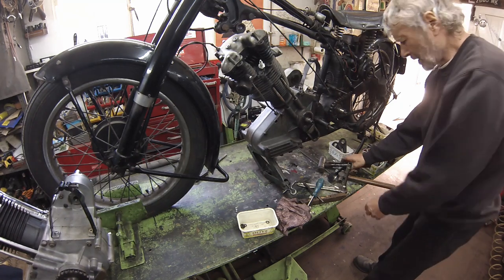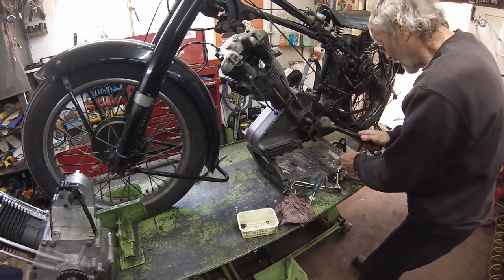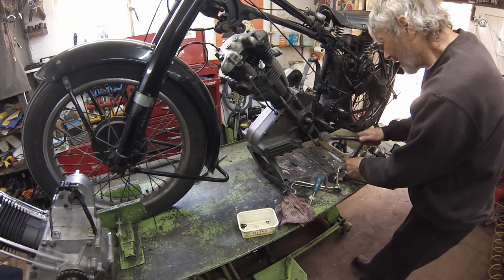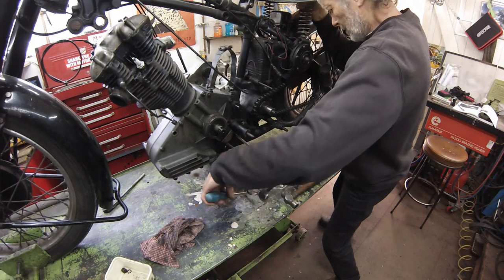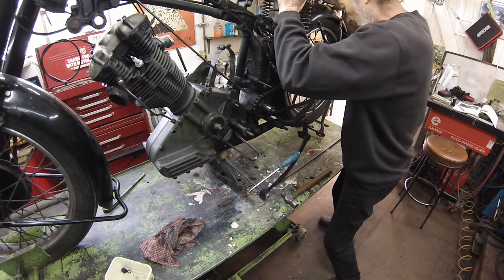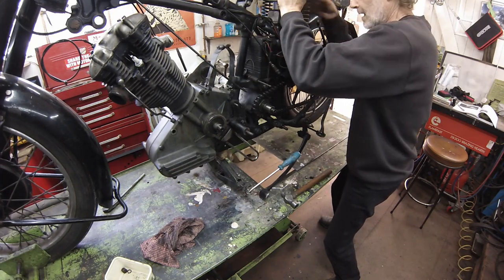With the long nuts off the top, I can drive it down, but it's considerably longer than the space between engine and bench. Getting clearance is hazardous because the rear stand is sitting on the removable plate. Hold your breath for me while I clamp the front wheel firmly and reposition the scissor jack under the engine plates to take the weight off. It's a bit wobbly until I set the stand back down.